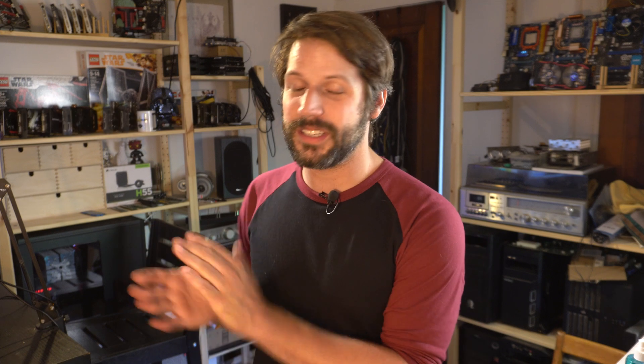But I know what some of you are going to say. You're going to say that the motherboard just isn't able to support that CPU, and that's the problem and not the power supply. Hopefully you all understand that 250 watts isn't going to power this system anyway. But just to prove that this is the problem, I'm going to hook up a different power supply - a 700-watt power supply - to this system and see if it boots and runs Furmark and Prime95 at the same time.